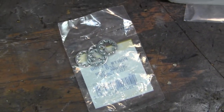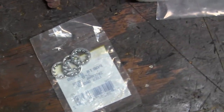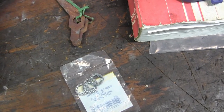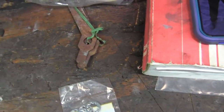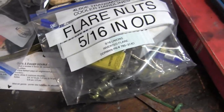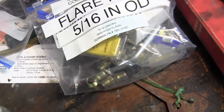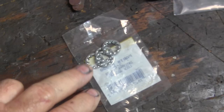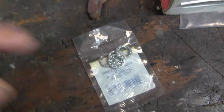The electrical grounding and bonding on the GMs are a problem with corrosion. I don't have a problem with this van, but I'm going to run extra ground wire anyway from the front of the engine to the back of the engine, to the ground for the fuel pump, because so many people talk about fuel pump failures. I also bought a kit on Amazon that has a lot of these, I can't find it right now. I'm having a hard time finding these in a lug that I can solder to. Yes, I can put a connector on it, but that's neither here nor there.